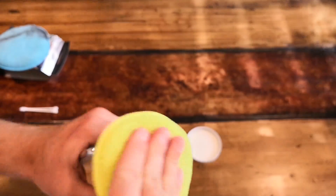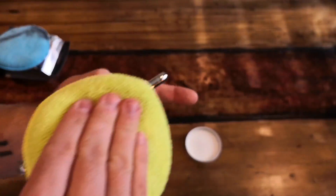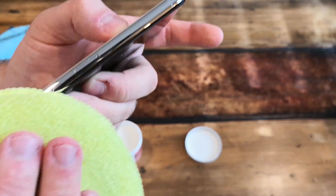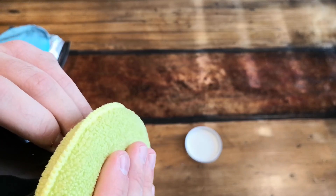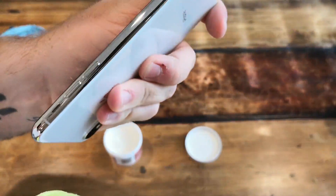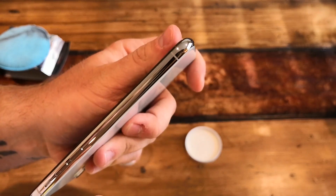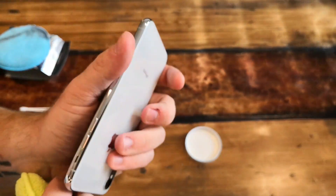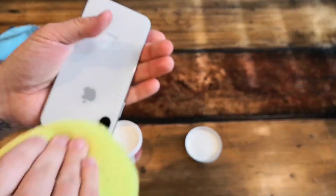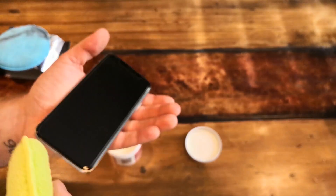Little tidbit of information: this is actually the second Apple phone with stainless steel. Most people don't know that the iPhone 4 and 4S also had stainless steel side rails, but because they had an anodized or finished top, a lot of people didn't realize it. This trick would not have worked on those because polishing would have ruined their coating. This will not work on aluminum phones with a special color or anodized coating on the edges.